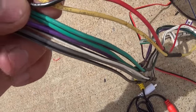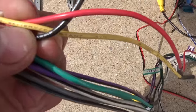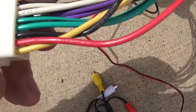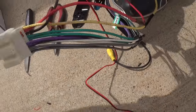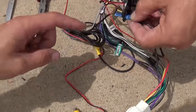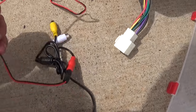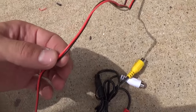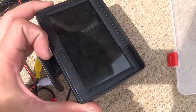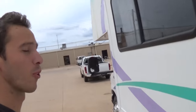We were actually about to make a mistake. The black is ground, but the yellow one is battery constant - we found the reading on it and measured with the voltmeter. The red one says ignition switch, so that's actually the one we need. We'll connect it to the black and the red - pretty convenient since black goes with black and red with red. We also need to connect the screen, which has two more wires - black and red, negative and positive - so it will illuminate the little screen. Let's go see if we're going to burn something today - you never know with something we do for the first time!